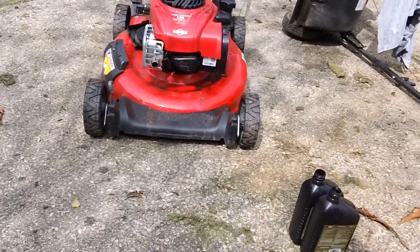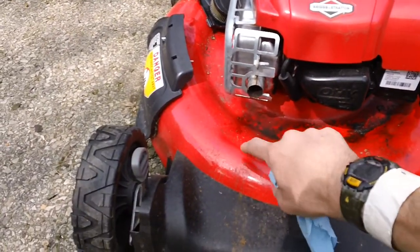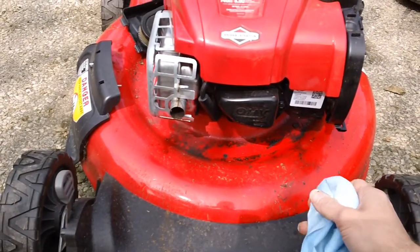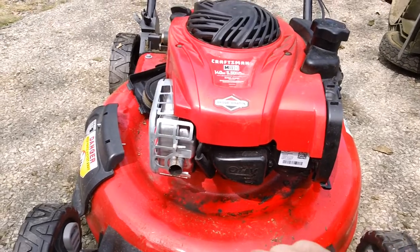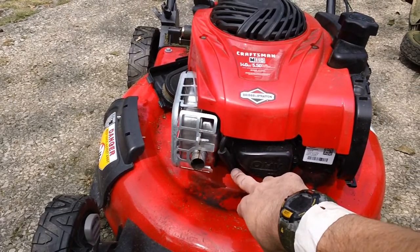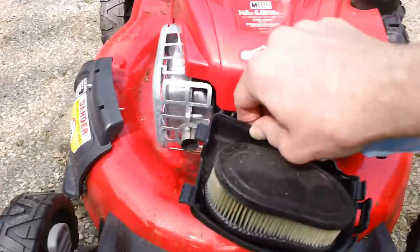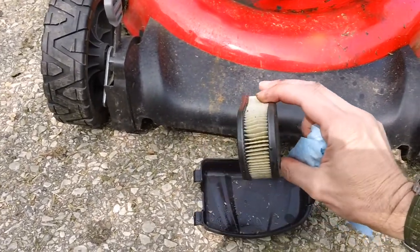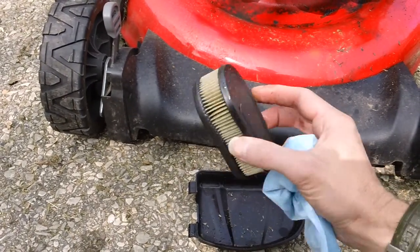There was a lot of oil puking on the actual exhaust, and there's all this residue here. There's also oil residue by the carb because you have your breather system over there. What we found was the spark plug was totally oil-fouled. The combustion chamber had a boatload of oil in it. The air filter — no joke — is totally saturated with oil. The entire air filter is just completely filled with oil.